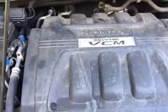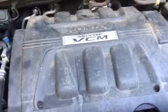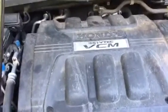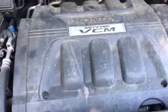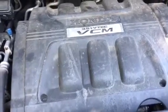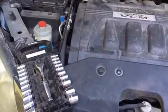What I'm trying to do is this: the way this van is set up, if the check engine light throws a code, the VCM technology stops working and this thing starts drinking gas by the gallons per mile. The modification I did is just to try to get that VCM to work again. The O2 sensors that are pre-cat have not been tampered with — these are post-cat O2 sensors. I've only modified one of them because a technician told me it was that specific one causing the problem — the catalytic converter right here in the front, which I gather is the one that messes up most often.